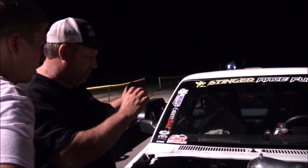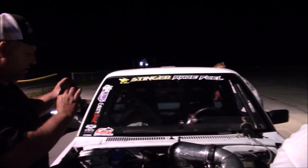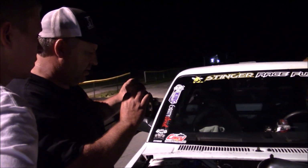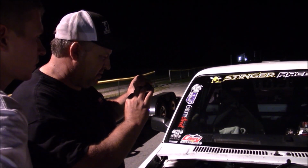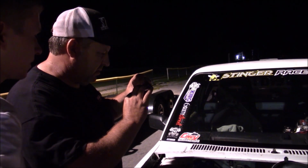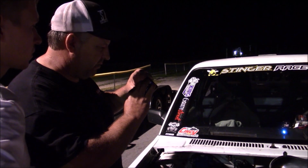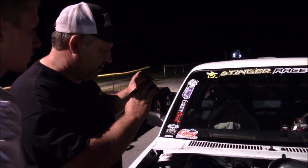Or you just get the oil up over 150 and all the methanol boils out. Wait a minute. If the engine's shut off, oh yeah, what'd the tach say? That comes from the coil. It did go to 0. Yeah, the tach went to 0, but the air fuel's still showing 429, 427. How's that? It's dropping.